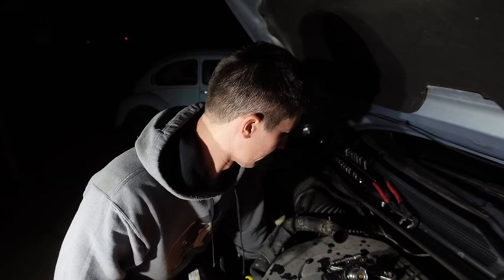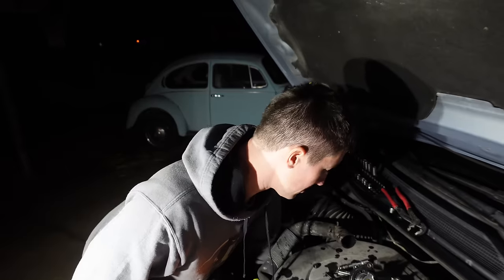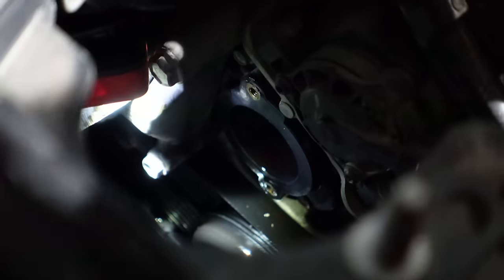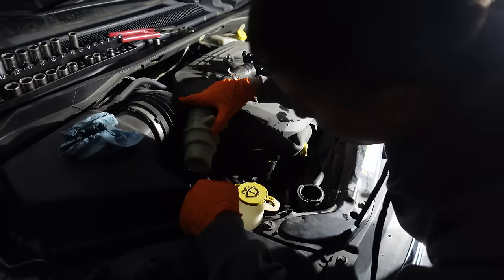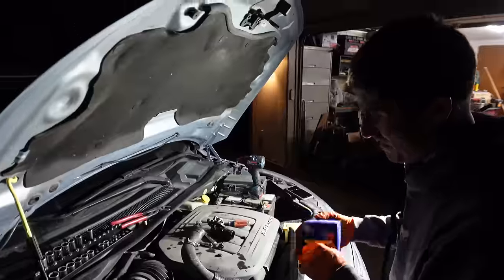Job done. It's right underneath the power steering reservoir. If you take off the one bolt for that, it really does buy you all the room you need to get this whole job done. Two bolts hold it on. It's a 13mm for the reservoir bolt and that's all you need. I'm going to make sure this thing's nice and clean. Now you guys can see where the thermostat housing mounts right there. Just don't break off your cam position sensors — they're right there and close to your work area. Your job's going to get a lot more expensive if you break those off.